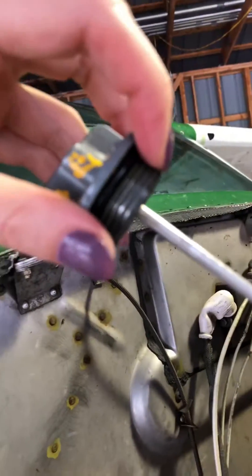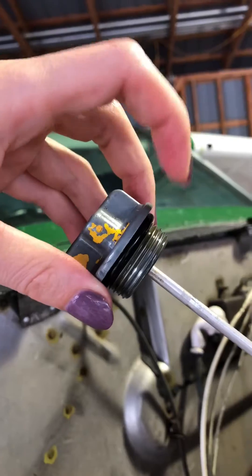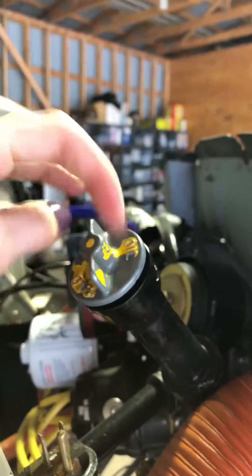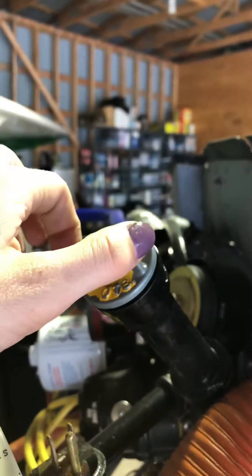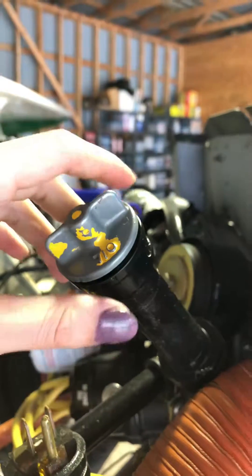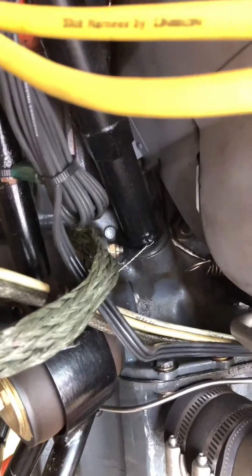The main thing to note here is this rubber O-ring. This rubber O-ring is what helps seal it, and that's why we don't have to go super tight. So we're going to put it back on clockwise to tighten it, and just finger tight — a child should be able to get it off. That's all it needs. That way you don't over-tighten the plastic tube and break it against the metal case.